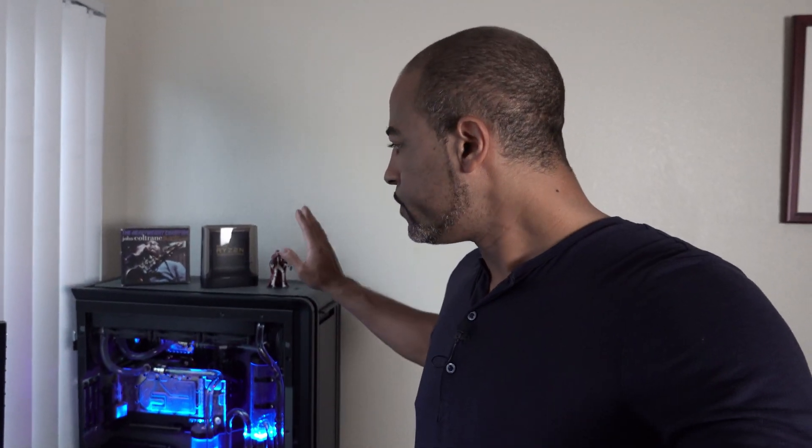I'm going to be replacing the water block. This is the Optimus water block that you may have seen in previous videos, and they sent me basically updated hardware. I'm going to show you how to update the hardware for a water block when you have that opportunity. This is going to help with the mounting pressure because Threadripper 3 is very finicky when it comes to mounting - sometimes you have to mount the processor two or three times just to make sure you have it right. I also have to drain this system, and I'll show how to replace a water block in a Threadripper 3 system, and then fill it. I'm going to break this up into a few different videos, but for this one, let's work on this water block.